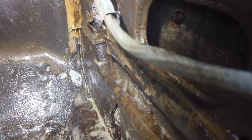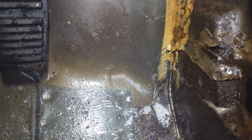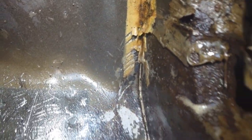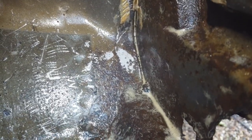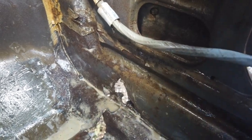The sill will then go on the outside as well, so the sandwich is: the inner sill is sandwiched between the inner floor edge and the outer sill lower lip. Reasonably easy job to do - and not as much rot on this side as expected. The difficult shape up there in the far corner looks like it doesn't need any work, so that saves a lot of those complex shapes.